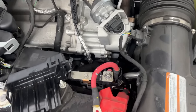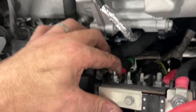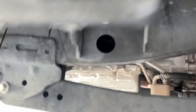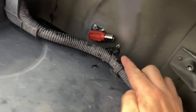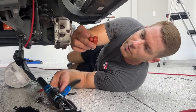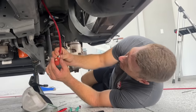Here's how I ran the Stinger four-gauge: off of this fuse panel, here's the power wire going down. This one goes over to the upfitter switch power relay box, then I pulled the inner wheel well to get better access and attached it to the harness going down into the back of the truck. The power wire comes back up under here, and here's the bottom side of that connector underneath the passenger seat. We'll get our crimp fitting on here and do a couple heat shrinks.